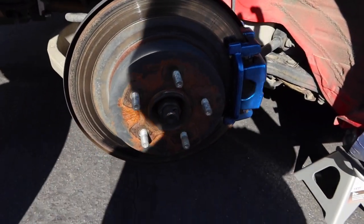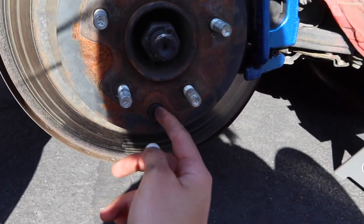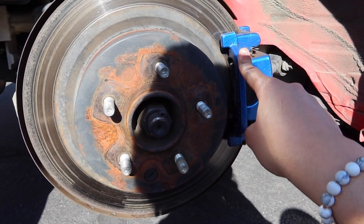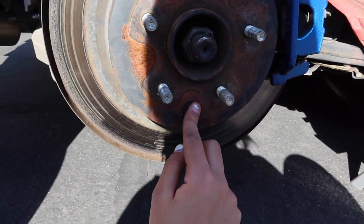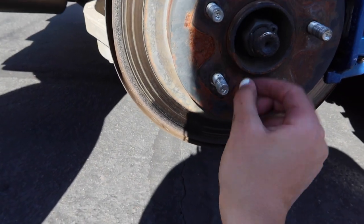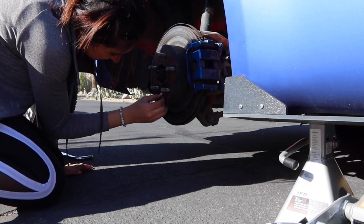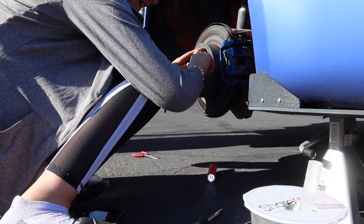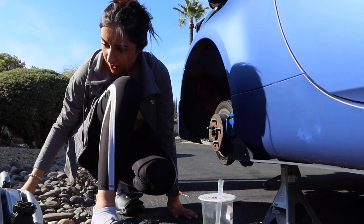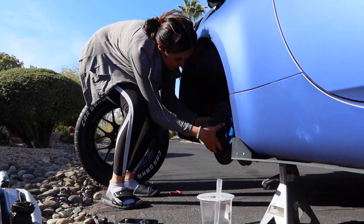It's a little bit windy, but I'm going to show you guys exactly where the e-brake adjustment spindle is. It is right behind this rubber piece right over here. You can take the whole rotor and, obviously, the caliper to adjust it, but you can also do it through here and just try to fit a tiny flat head there and just readjust it. So that's what I'm going to be doing — I can just expand the e-brake around it, and I will also have to do that to the other side. I just realized I have to rotate this whole rotor. I need a good rock to hold the car up in case it does start falling and rolling backwards.